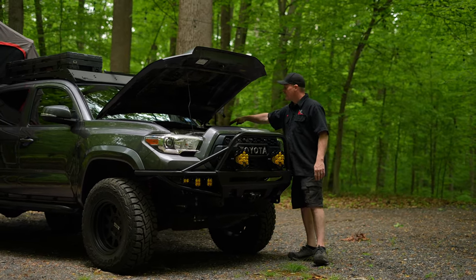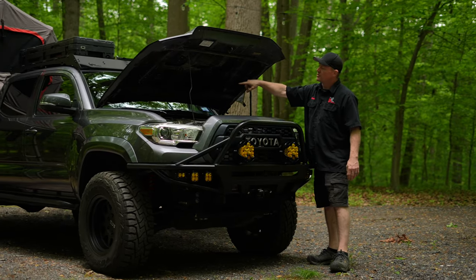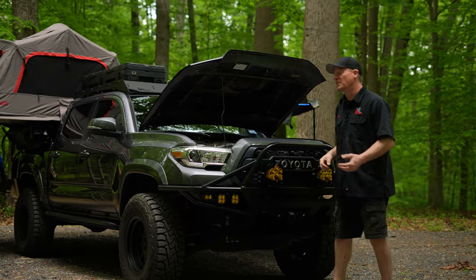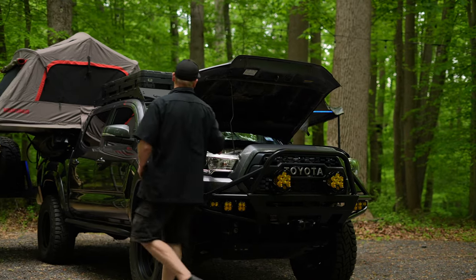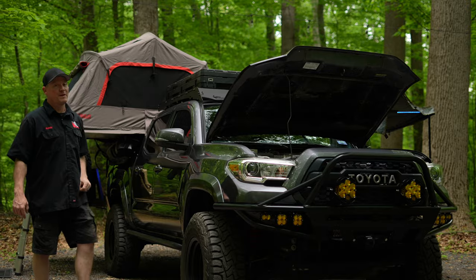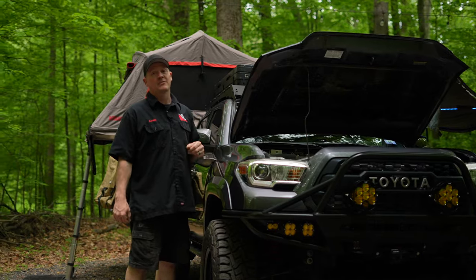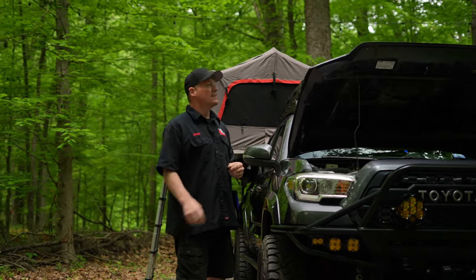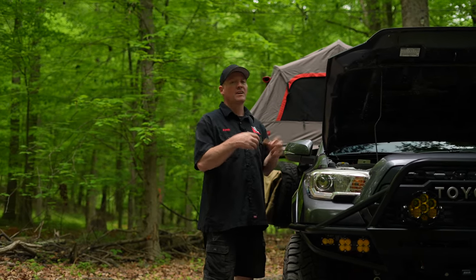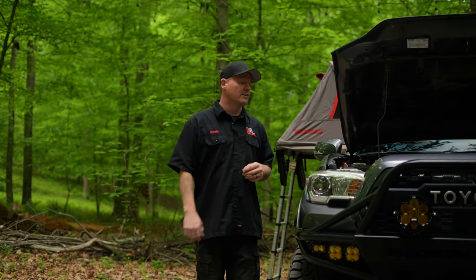I've added a couple of power distribution centers and fuse holders over here. I've also run to another set of distribution panels because I've been adding so much to this vehicle. On this side I have a solar controller. I added a solar panel up here to the roof of the vehicle. That solar panel keeps my auxiliary batteries charged whenever we have a good shot of the sky. I've only had it out once for a camping trip since installing the solar panel — ran a fridge all week, ran my lights all weekend, everything went great, and the car fired up just like normal.